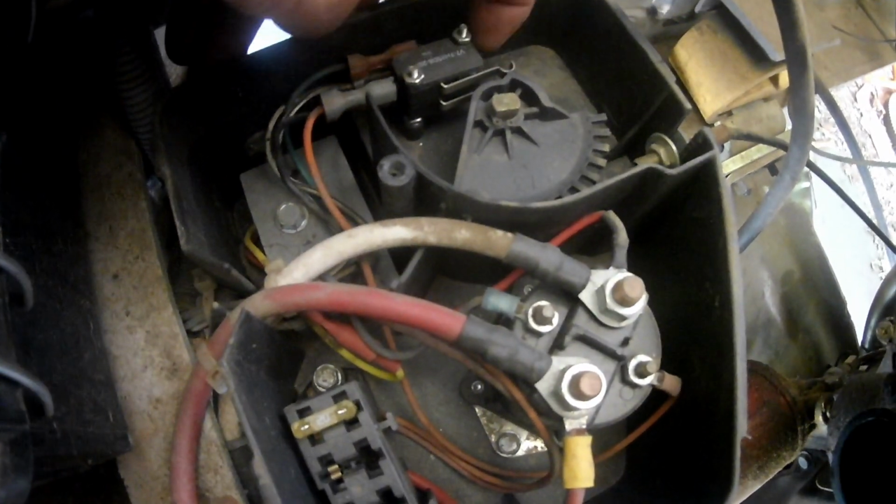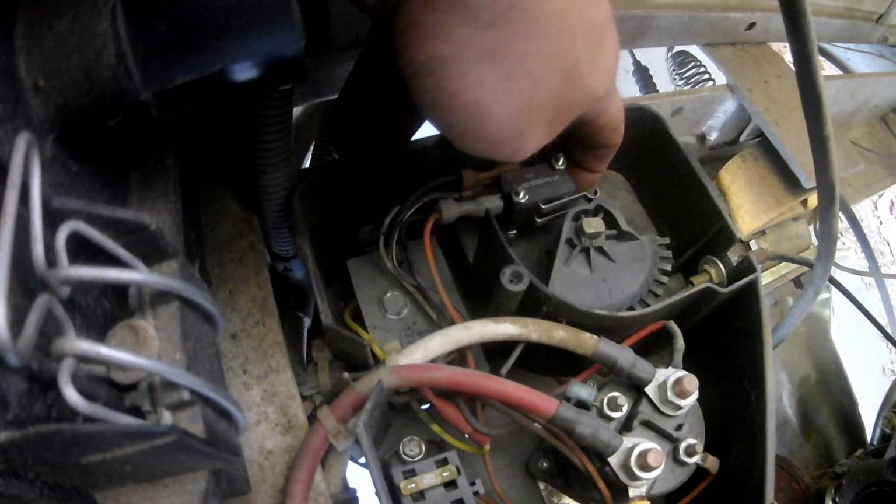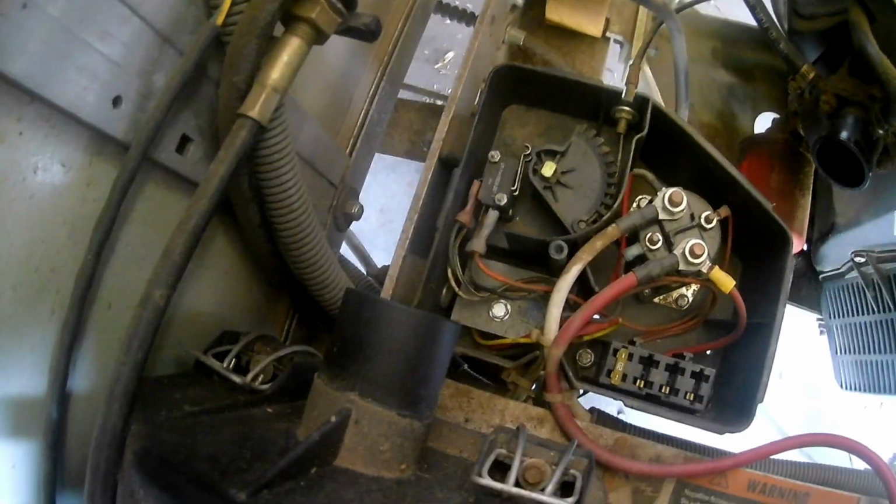and in most cases for the Club Car it's going to be in the micro switch area here, and there are two micro switches here. Okay, so one's for your solenoid activation, one's for the kill to the spark to cut the golf cart off when you take your foot off the gas. In most cases, if the cart is still running after you take your foot off the gas, the bottom switch, you can see you got two prongs right here on these switches, one at the top and one there at the bottom. That bottom switch is going to be your problem, because that's what kills the engine when you take your foot off the gas.